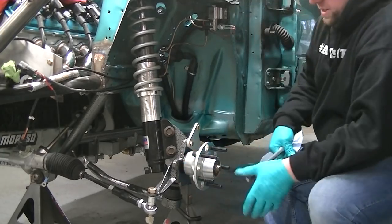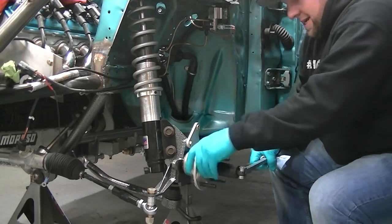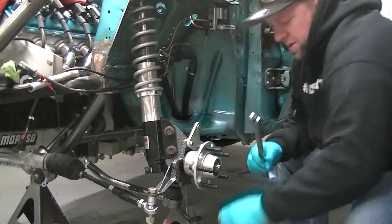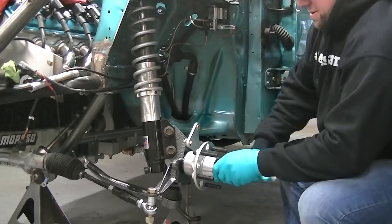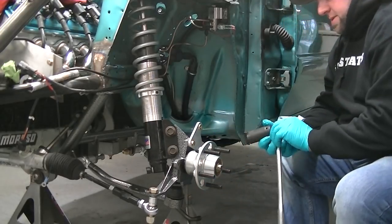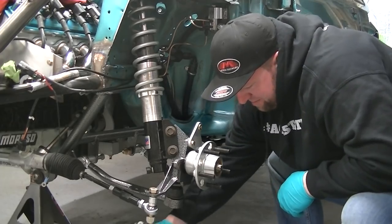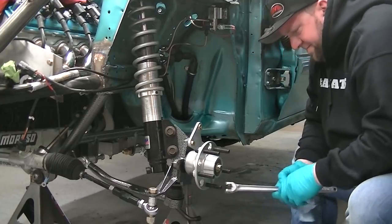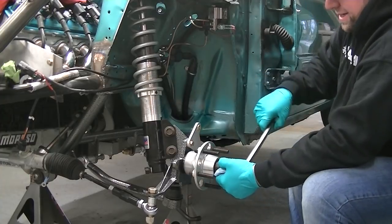You don't want to just lock this thing down and call it good or it won't spin. There is a torque procedure to this. You lock it down to about 17 foot pounds and back it off so you can seat the bearings and races. Make sure your bearings are seated well, spin it back, and it feels solid. Anybody who's done this before knows. And this is why Craftsman tools suck - that's an opinion, don't worry about it.